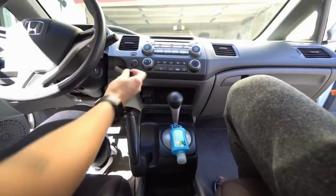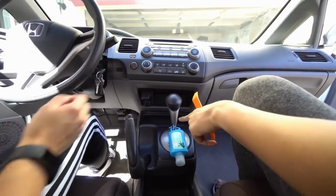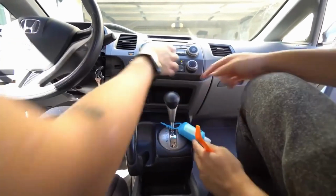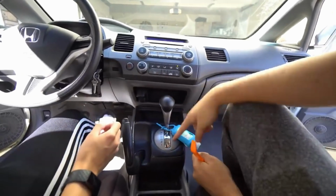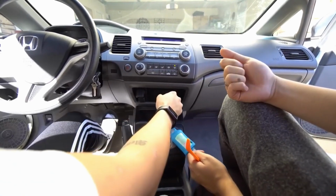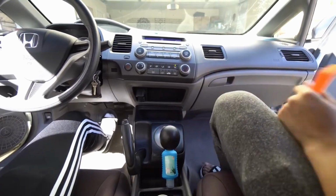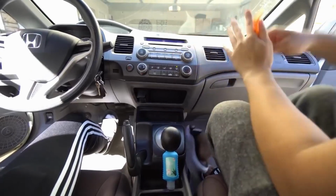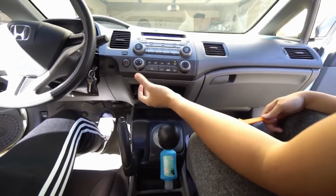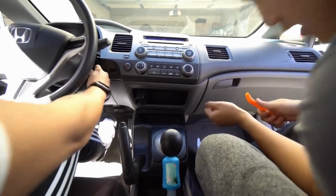Okay. Turn it on. Don't turn the car on, but have it on the on position. And then we're gonna have to move all this out, so let's put this into first gear. Make sure it's on the e-brake. No, have it on the e-brake, okay. And just shift it into gear. To one. Then you can turn it off. Make sure, yeah, we're good. So this will give us clearance when we're removing it. You can turn off your car now. You can take it out.